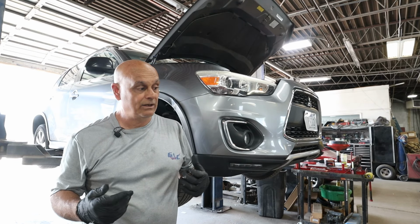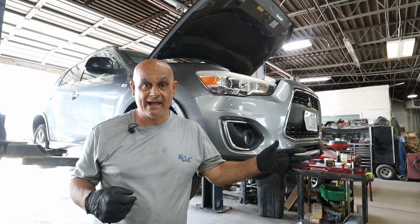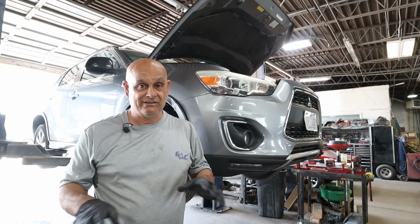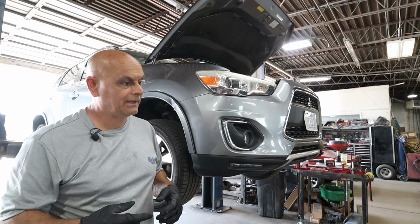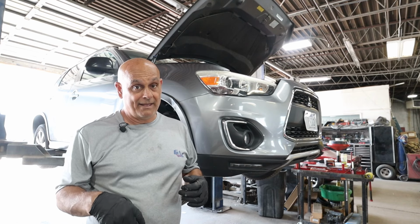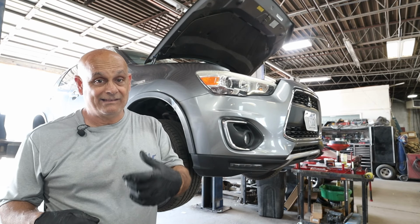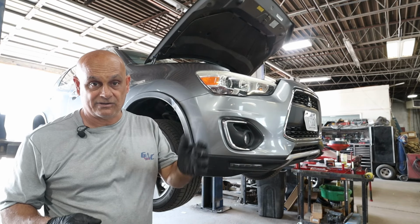I looked at the vehicle, and what I found was kind of hard to get you guys down in there, but I'll tell you what I found. I did an evac on it, pulled it down, got it at 0, did a leak test on it for like a 20-minute leak test, I think it was. It didn't leak at all. I put Freon back in the vehicle, started it up, turned the AC on, and while the AC was running, I took my sniffer and sniffed all around.